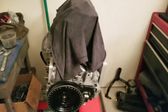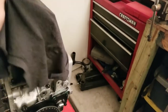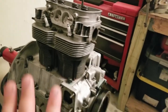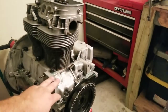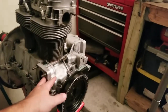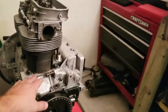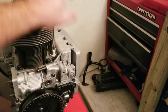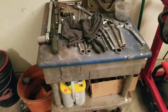So I got the engine over here just kind of chilling out. It's ready for me to do the other half of the engine. I've got this side on, and I had a question about long blocks versus short blocks. Before you put your pistons on and you put your heads on, you've got a short block — just a case with the crank inside of it and your rod and stuff assembled. But once you put the actual cylinders on, your heads and your rockers with the push rods, you've got a long block.